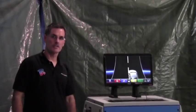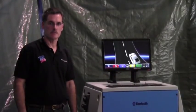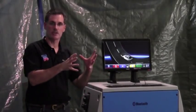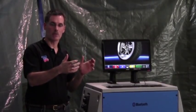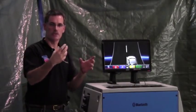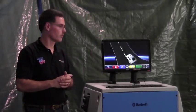In this video, we're going to cover the operation of the RAV 1760 car alignment system. The 1760 is a six-sensor system. Your front heads will have the long boom, and your rear heads will just be a small containerized unit with no boom. You'll have one single camera in the back, whereas your front sensors have a camera in the back and one in the front also — two cameras on each front head, a single camera on the rear, three heads on one side, six cameras total.